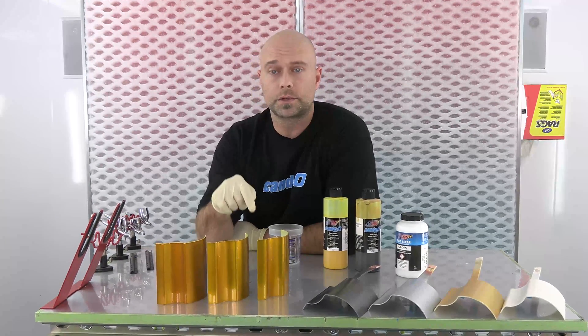Welcome back. We are about ready to put the finishing touches on this project. While you guys were away, I finished the last couple coats of candy and put a little bit of 2K clear over the top. Now we can really check them out with the light. So remembering from the very beginning, I talked about the process to come up with this Pagan Gold color. The darkest was a two to one, this is the three to one mix, and that was the four to one. These two were really close but I opted for the three to one — that was the closest over a silver base coat, our 6013 silver sealer. Three parts lemon yellow to one part tequila yellow was the ticket.